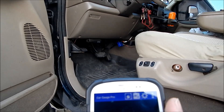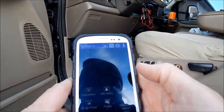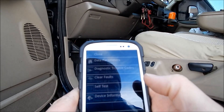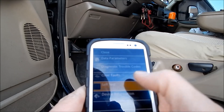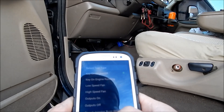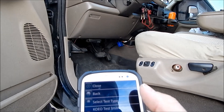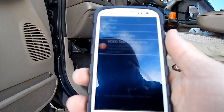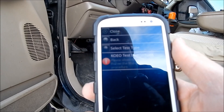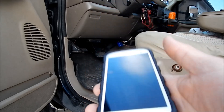From there, I think it's on the three-dot menu on the far right. Click that, OBD menu, and it says self test. There's a whole bunch of them. Here it is — diesel injector buzz, key on, engine off. Click that, and all eight of my injectors buzzed.